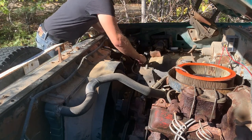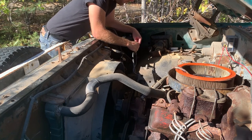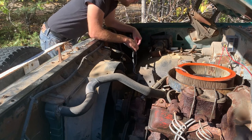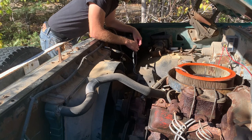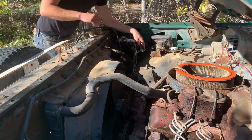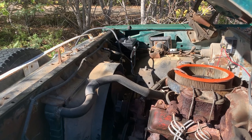Now, before throwing both on, I'm just going to give it a little bit of a test. This truck has like zero power options, so it shouldn't spark or arc out or anything like that. If it looks like a 7018 welding rod sparking, I recommend just shutting down your vehicle starting mission. No sparks. I don't hear anything. Don't smell anything. I think we're good to tighten this down and see what we have at the key. Let's see what we have. See if we have life in the starter now. Okay.